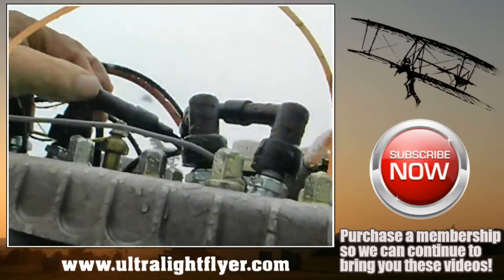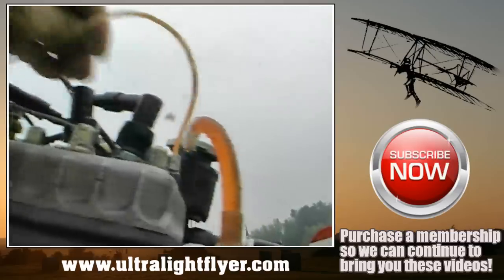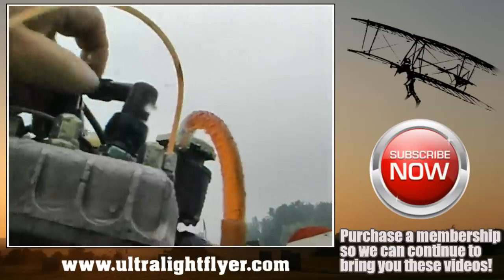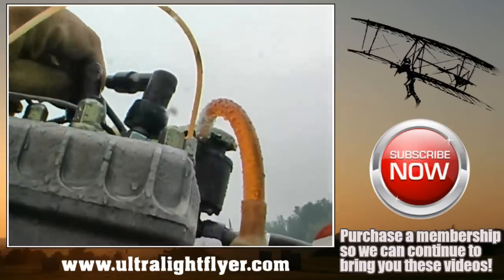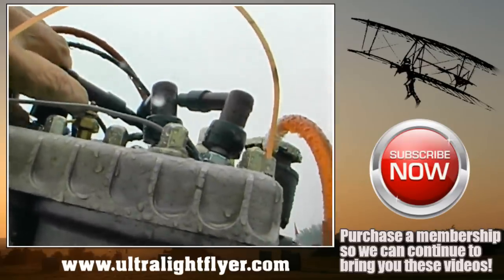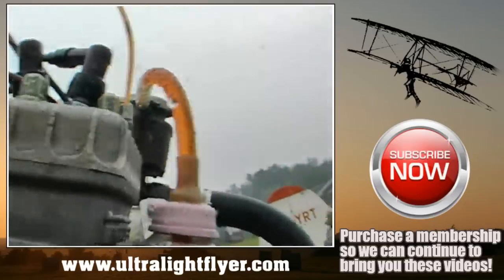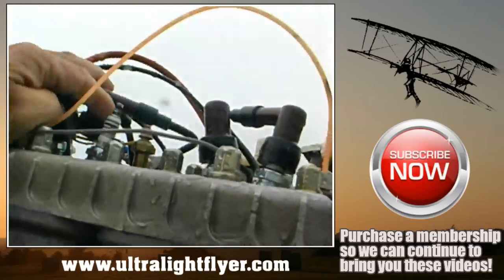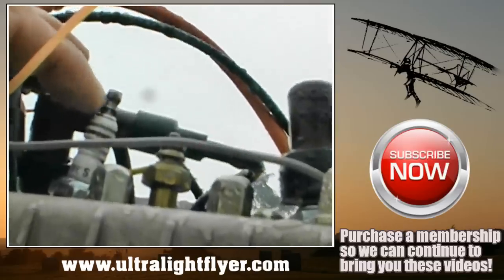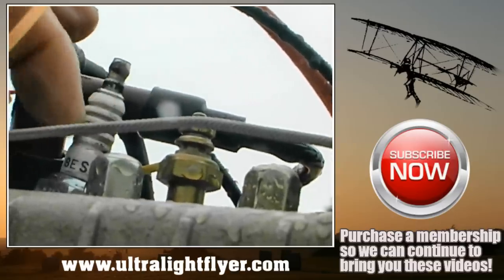This is the type of spark plug cap to inspect. You can see how this cap moves up and down — it's supposed to be very, very snug, like the other one here which I can't move at all. This one moves up and down freely. If you pop it off, you'll see the arcing. This cap has the aluminum top rather than the steel top, and you can see the arcing that is developing in the spark plug.